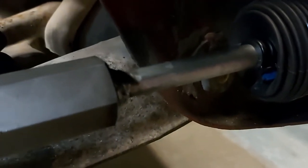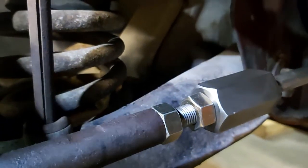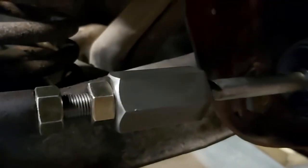The coupling nut on the other side is welded to our rack, so it's not coming out, not moving - pretty solid. It's 9/16-18 thread per inch, which is considered a special fine thread and hard to find as ready rod. I had to use a 4.5-inch fastener and extend the threads about 4 inches to get the proper length. We've got lots of engagement into the coupling nut - about 1.1 inches going in, and 1.1 inches on the other side coming out of the steering rack. Pretty stout, pretty strong.